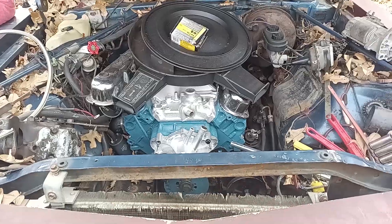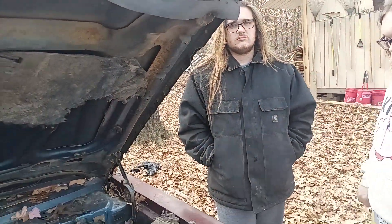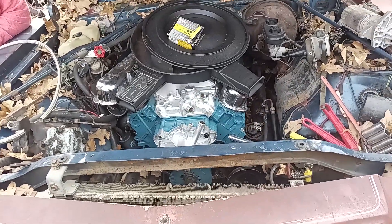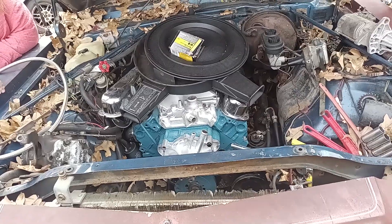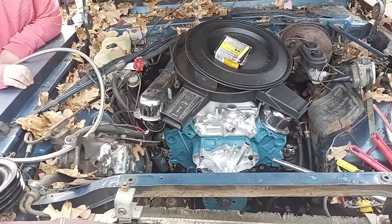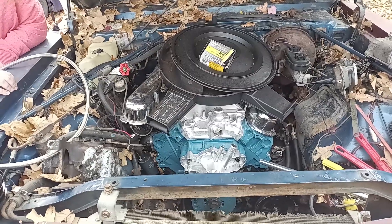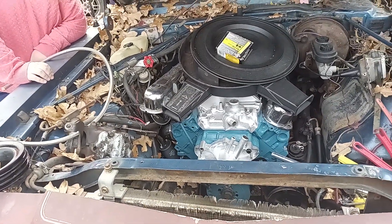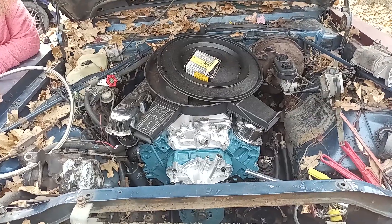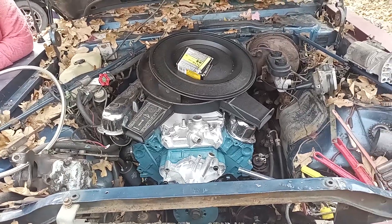Here's why. We're fixing to do our video on Seth's '72 Dodge Coronet. I bought the car with a brand new motor, the guy had put it together, and it didn't have enough power to get out of its tracks. First thing I could tell when I went to crank it over was the timing was slow. So we pulled it up, started it, started pulling the timing up — man, it started smoothing out. Pulled it up a little bit, it started cutting out a little bit, and backed it up. Let it run till it was warm, shut it off, went to start it — it kicked back a little bit, backed it up just a little bit, got it to where it was as far advanced as we could get it without it kicking back on the starter.